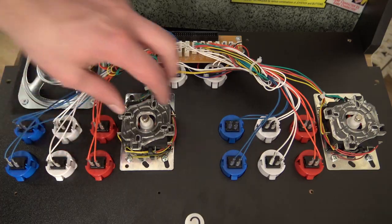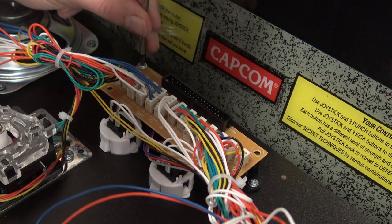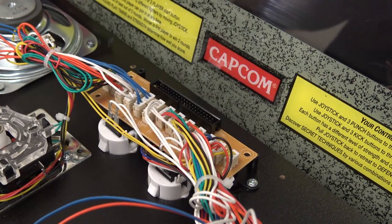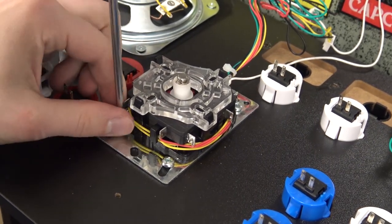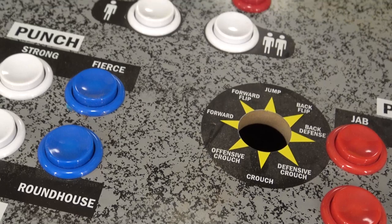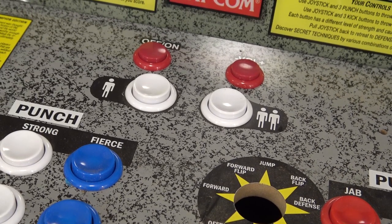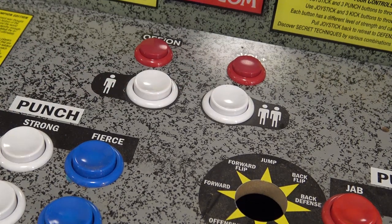In my case I removed all of my Cable 3 and the original encoder board. We're not going to need an encoder board because the Legend Connect has one built in, like a Pandora's Box - that's very convenient, and that's the reason why you need Cable 3. In my previous build I removed the joystick simply because it requires a lot of soldering, so I replaced it with two new Chinese joysticks. I also added two additional buttons - with the Pandora Box you need these for coin and pause menu.